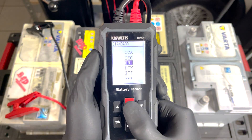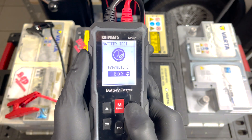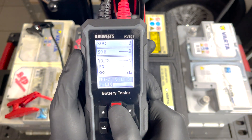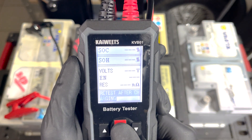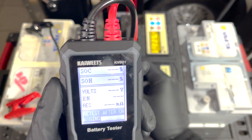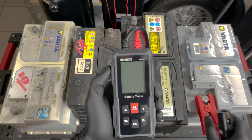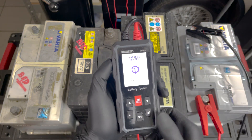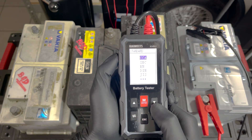For the completely dead battery, although it appears able to start the test, after entering the last parameters the device displays a message that the battery needs to be re-tested after charging. Because this tester uses power from the battery to do its tests, it fails to test very low batteries. More expensive testers have an internal power source, but usually when a battery is this low it is beyond salvation anyway.